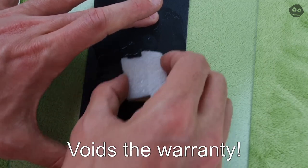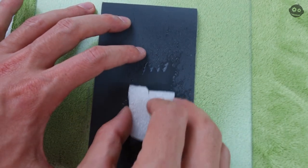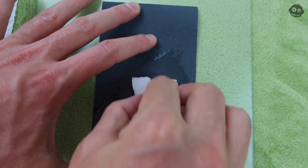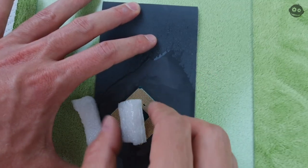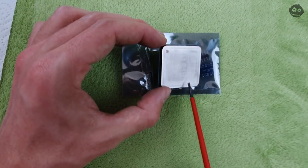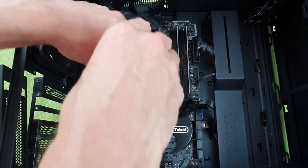Note that you will lose your warranty if you do that, so only do it if you're very confident. I went down to 1000-grit sandpaper — even finer — and sanded for a while with water, which helps to keep the sandpaper free of residue. You can see that we had some high spots on the CPU that we got rid of with this process, so we might see some improvement in cooling.